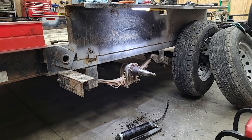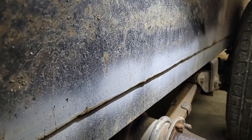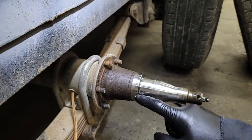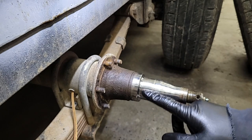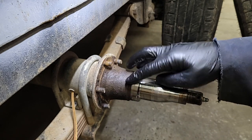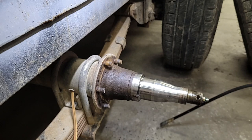Let's get you in here a little closer. In case you've never seen axles like this on a trailer — it's got this grease zerk and then there's a port back here. So when you put your grease in, grease comes out back there. I don't know what that is — pink Vaseline grease or something. So you can see that if you pull up to this thing with an air-powered greaser or a battery-powered greaser and you're just hammering on it, it's right back here right at the seal. Your seal rides right here and you're just pouring grease — it's just going to blow right past that lip seal and get all over everything. That's why those brakes were so packed up with grease. So you've got to be aware of what you're doing.